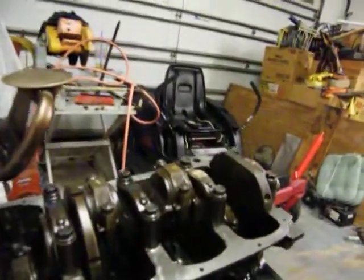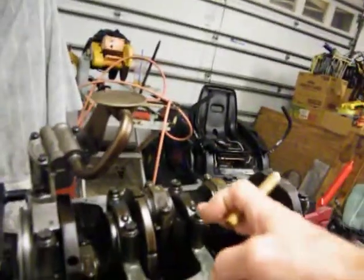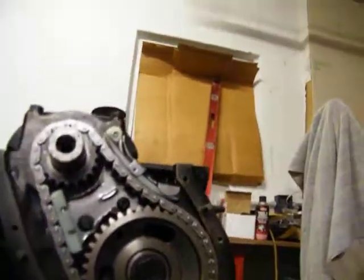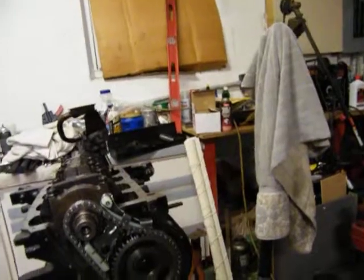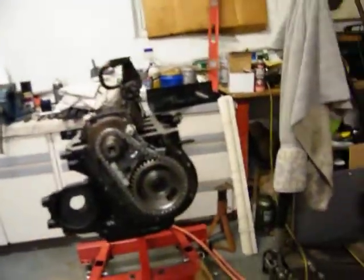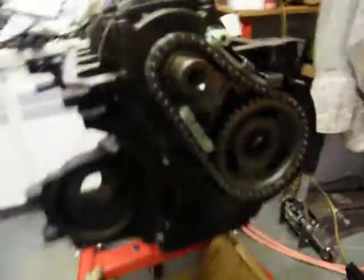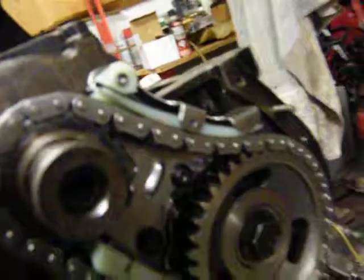I still haven't found any other specs on this thing, so I'm at 70 pounds on the mains and 38 on the rods. What I'd like to do is change that little bolt right there — why couldn't I put an Allen head in? I can. I'm gonna take that out and get an Allen head and put it in there, cause it shouldn't hit. That star is no good on that one so I'm really not getting a good torque. I'm not worried about it coming out, but for safety's sake I'd rather have it right. I got plenty of room — I could put a short-headed Allen head in there, no problem. I'll go to Ace and get one tomorrow.